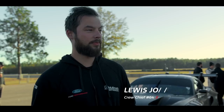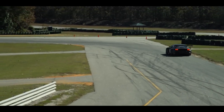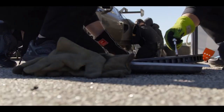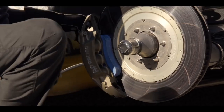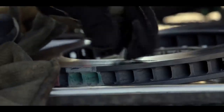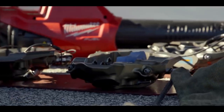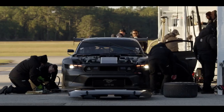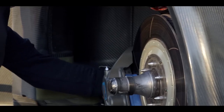We found some little issues that we kind of preempted — we knew we were going to come across them. You have to tap it up so you don't just let it go and see how far it goes. We're having some pretty extreme knockback. Knockback is when the pads that clamp on the rotors get literally knocked back away. When you go to the pedal, you recognize that as a long pedal. In a lot of race car setups, you run knockback springs and seals — they don't necessarily drag, but they hang out real close, so every time you go to the brake pedal it's right there and it's consistent. You do not want to go to the brakes and question if it's going to be there. That's terrible for your mindset as a driver.